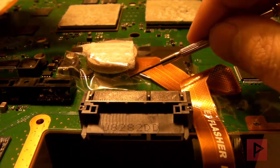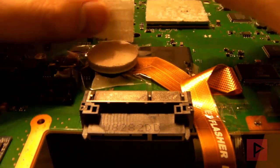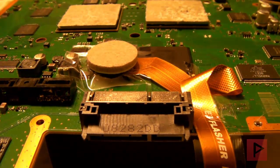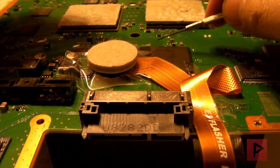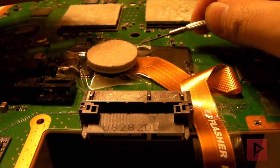What I ended up doing was a three-step approach. First, I had the NOR chip and what I did was I shaved off the right-hand side and the left-hand side of that NOR chip clip, because apparently there is a resistor on the chip on both the right-hand side and the left-hand side that I never accounted for.